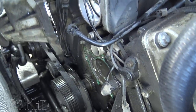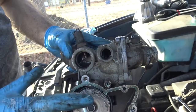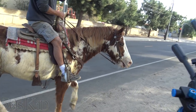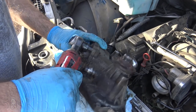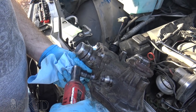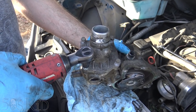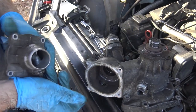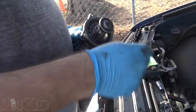Look at that — got lucky. I think that's bad. As you can see, we've got O-rings in here. Your new water pump should come with O-rings. This housing is going to unbolt and transfer to our new pump — we just need to unbolt it. You can see we've got an O-ring here, and we actually got a new one in our kit. That could have been reused in a pinch — it's still pretty rubbery, still pretty springy.